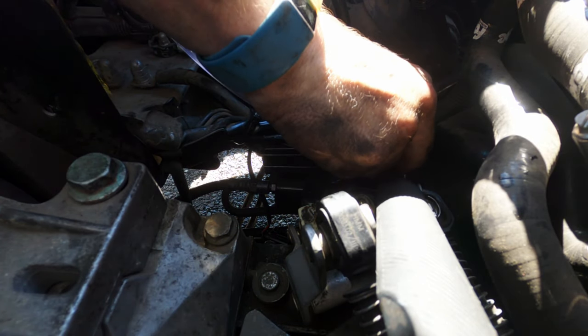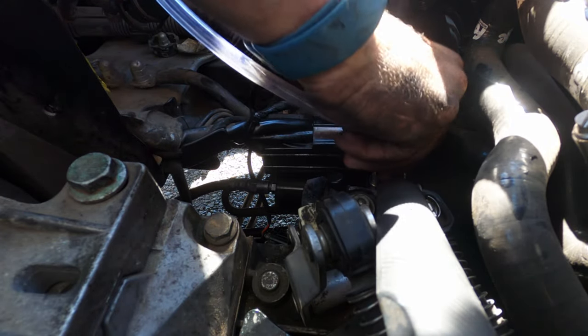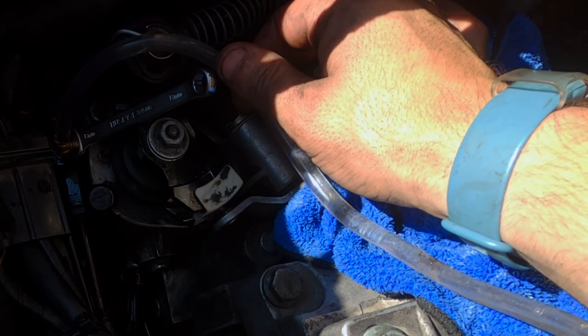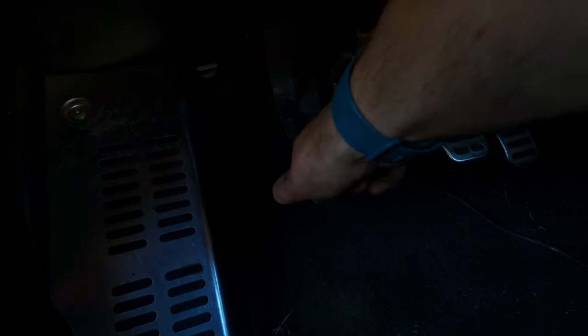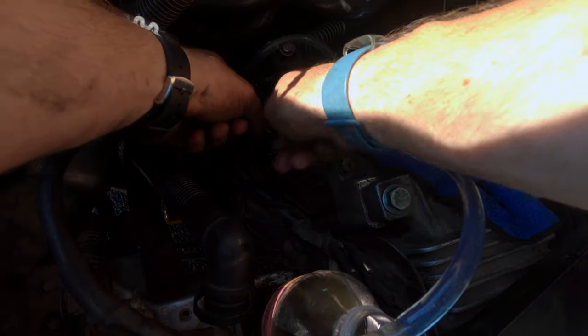When you do get the O-rings replaced, you can snap everything back into place and get ready to bleed the system. Bleeding this is nowhere near as difficult as bleeding brakes. This aftermarket bleeder valve has a one-way valve, meaning air can get out but nothing can get sucked back in. All you need to do is crack open the bleeder slightly and start depressing the clutch. You'll see air bubbles come out. The only way you could suck in air is if your brake fluid reservoir runs out of fluid, so you want to top that off as you go. My approach was to pump the clutch a few times, then check the level in the brake reservoir, and repeat this until I didn't see any bubbles coming through the line anymore. Then you can tighten the bleeder valve — unless it's tightened, you're not going to have much or any pressure in your clutch. You'll know you sucked in air or have a leak if you press the clutch and rather than springing back up, it stays down with almost no pressure behind it. First place to look is to make sure your brake fluid reservoir is full. Once that's done, you can button everything back up.